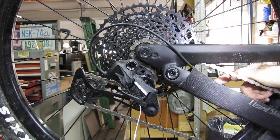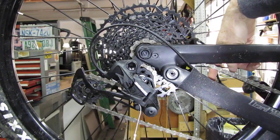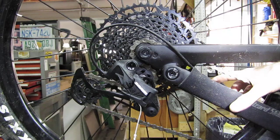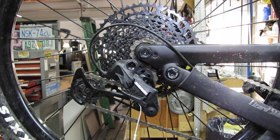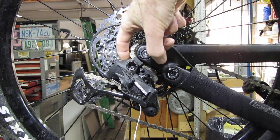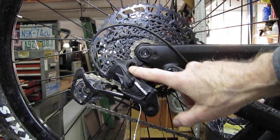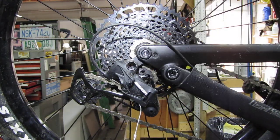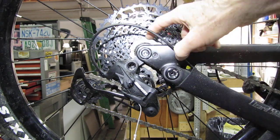The rubber cap on the speed sensor fell out on the floor this morning. Look on your other chain stay over here — I put a little bit of weather strip adhesive on the rubber cap so it wouldn't come out. That's something to check while you're in there. Also check that your derailleur is tightened on the hanger really well. I took the derailleur off and used a Park tool to align it — I'll show you that in a minute.